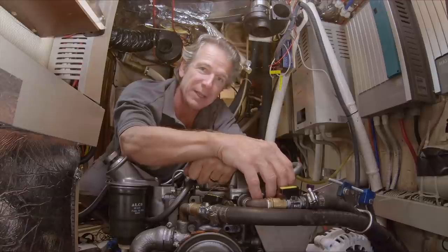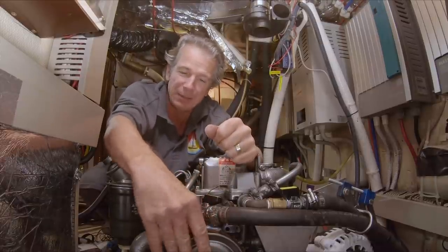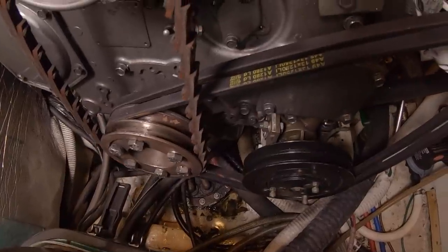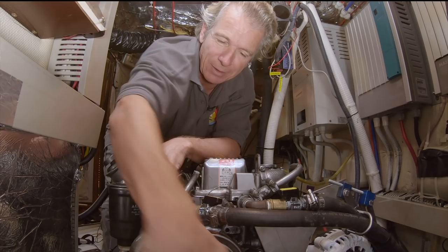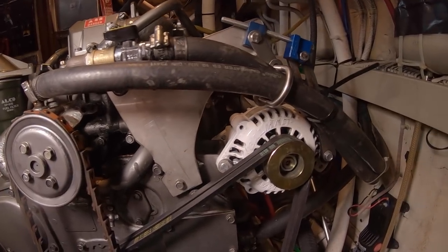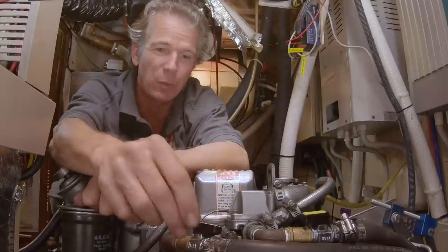You can see from the system here I've got double V-belts on. It probably would have been better to have serpentine, but that would have meant changing all the pulleys. Given that I've got doubles, I had to find a way to also drive the water pump from the crankshaft pulley — so I've got a three-groove V-belt on the crankshaft and just one of those drives the water pump. You don't want too much tension on that belt or you'll stress the bearings in the water pump. I've got a 180-degree wrap on that belt, whereas normally you'd only have maybe 90–100 degrees, so I don't need as much tension. The water pump doesn't take much force to turn, so it's a very good way to have that separate.